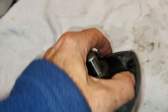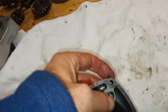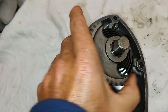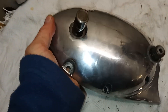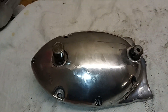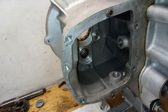Then we've got this spigot on the casing, and the end of the kickstart spring goes against that. That's what allows us to tension the spring for the kickstart, so the kickstart lever will return back up after we've kicked the bike over. So that's the outer cover basically ready — all we're doing now is waiting for a couple of parts to arrive, and then we're ready to reassemble the gearbox.